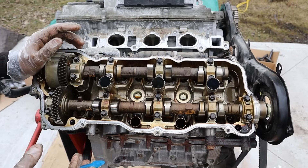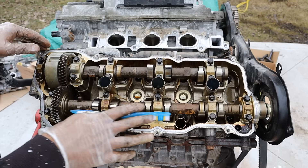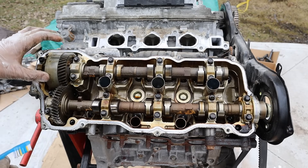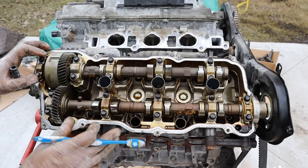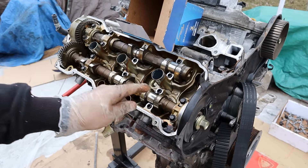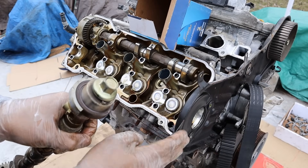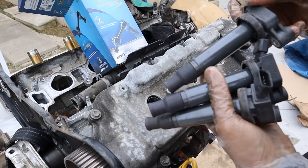Taking a look inside this engine, things are super clean — especially for a 1MZ engine known for sludge buildup. You can see the dual overhead cam design with the exhaust camshaft driven by the timing belt, and then a gear on the opposite side that drives the intake camshaft. This is also your variable valve timing gear — I have another video on how this works. In order to get to the head bolts I need to remove all the cam caps and camshafts. The camshaft caps and camshafts themselves are absolutely clean. Another tip: make sure you replace the cam and crank seals when doing your timing belt job. Also, all the ignition coils here are dry and made by Denso Original.